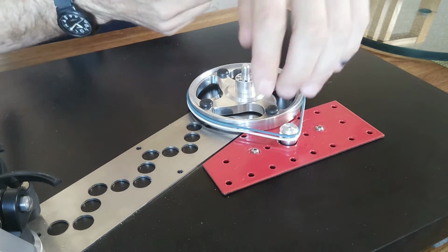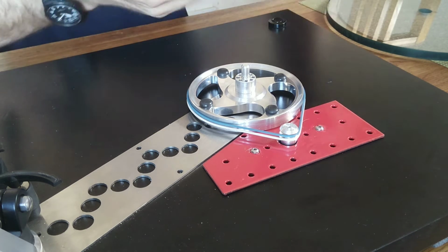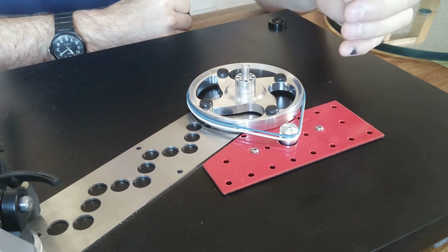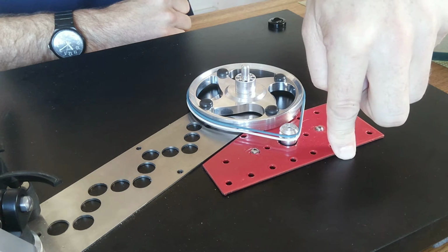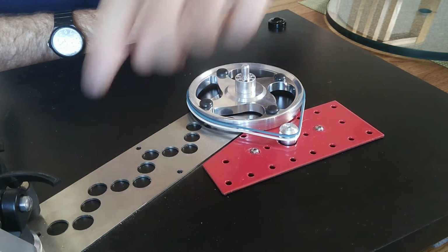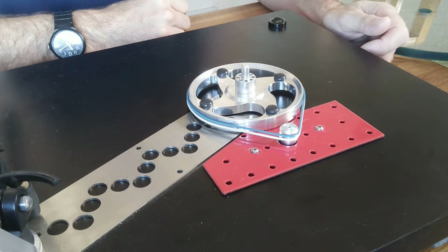And with the two plates together, the phenolic resin was actually warping, which I wasn't happy about. So the two plates really clamp that resin nice and bring it back to the original profile that it should have had, particularly as this plate here bridges beyond the cut in the chipboard. The other thing I've done is you'll notice this brace here, which is something that is done on the modern Planar 3s, but this being a version from '96 didn't have it, so it's something I bought, laser cut, very cheap, another eBay or Amazon purchase.